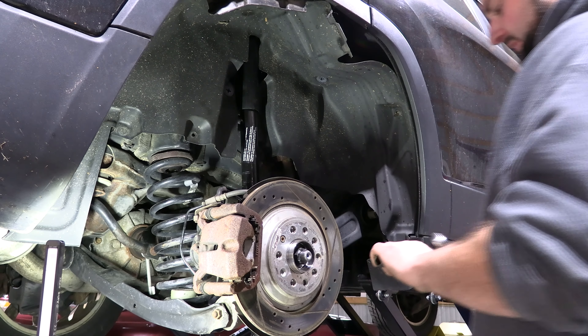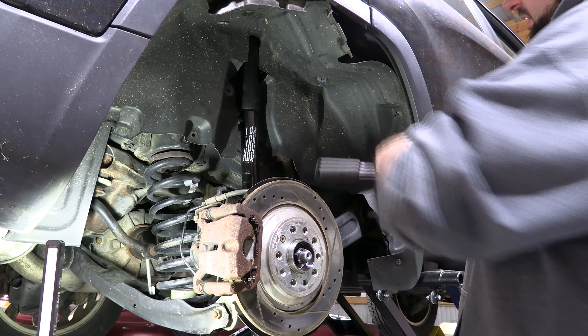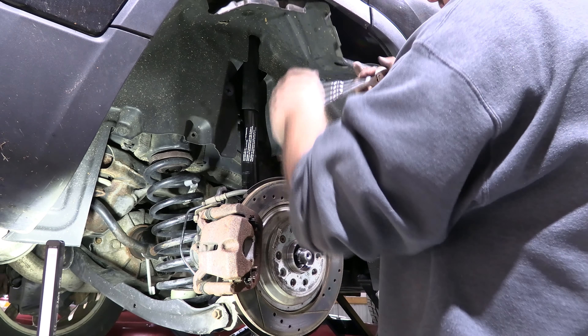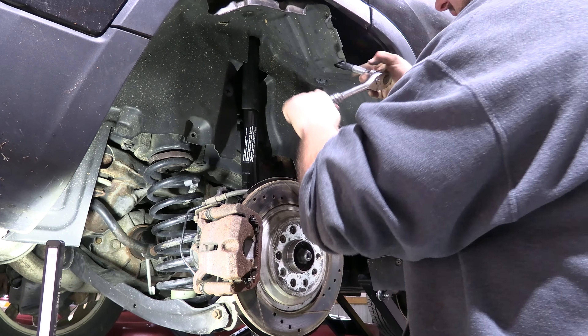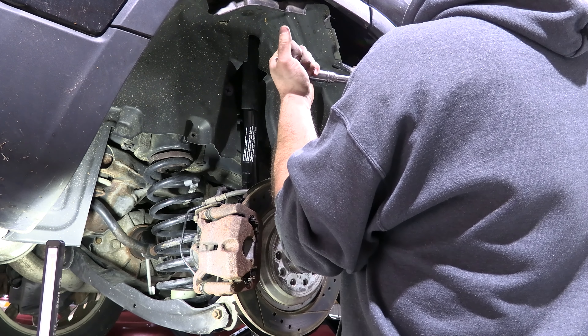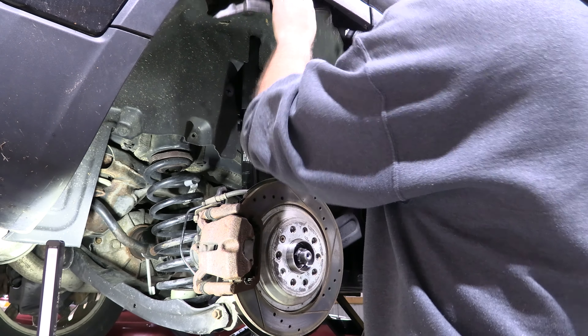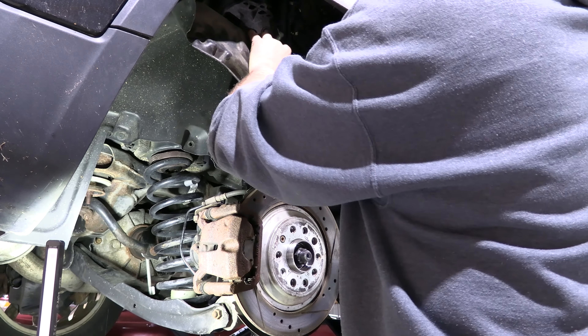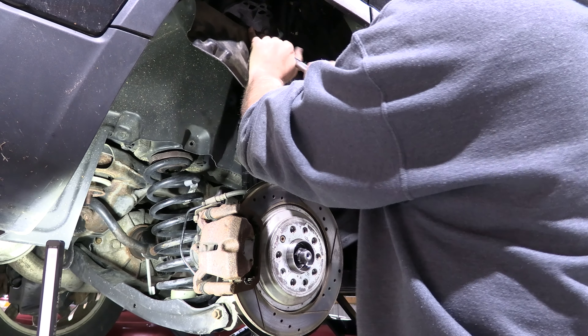Take my rag and clean up any excess — try and make your work look a little presentable. If I had thought about it I did order a new bellows, but I didn't realize until I opened this that it didn't come with one — not a big deal. I'll put a new nylock nut on top and run it down. Normally I'd put a small wrench on top of this, but the nut resets in this bracket, so I put a real thick rag around the rod so it won't mar it — normally you wouldn't do it that way. There we go — nice and clean, no marring on the shaft and we're nice and tight. Now I can put this back in.